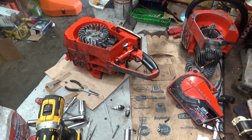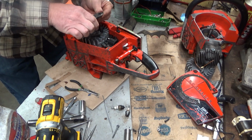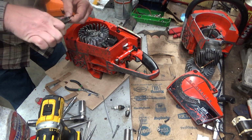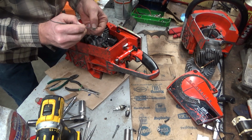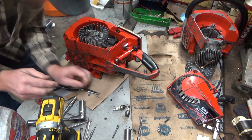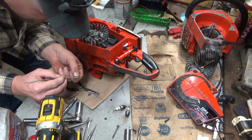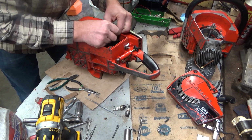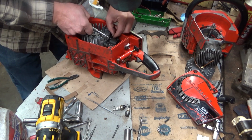Alright. Over this, that lead's broken down, or not broken, but the insulation's broken. I would say the most common thing on a 925, even more so than somebody leaning it out and burning it up, ouch, is these damn leads that are buried under here that get hot and break. Whether it's the insulation or the whole bloody lead, doesn't really matter.